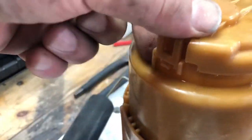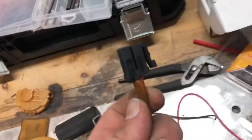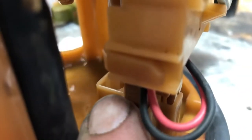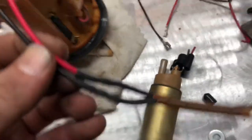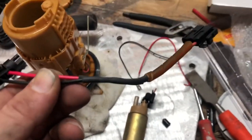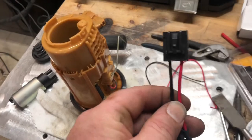Be gentle with it — plastic that's old is usually a little brittle. Then all you do is disconnect the old fuel pump. There's a connector at the top; this connector was in there and I just removed it. I cut the wires on the old fuel pump because my new fuel pump for $20 has a connector on it instead of screw terminals. So I just soldered positive-to-positive, negative-to-negative from the old harness to the new harness.